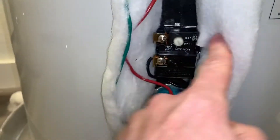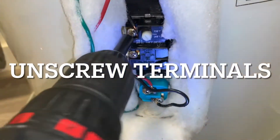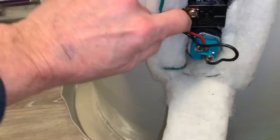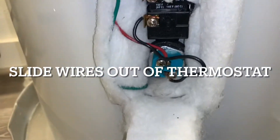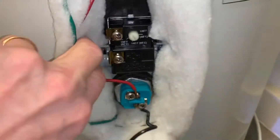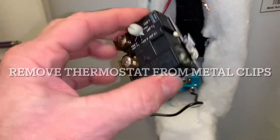So now what we're going to do — these are actually super easy. I'm just going to go ahead and remove these wires. I've already replaced the elements here. That one's going to go in the top, and here's the bottom one. These just pop right out. This is held in by a clip — there are a couple of clips right there on the side. Just pull those clips towards you, pull it towards you and it'll lift out. You need two hands, so I'm going to put this down and pop that out. They just come out just like that — that easy.